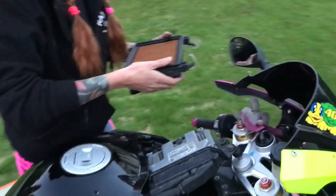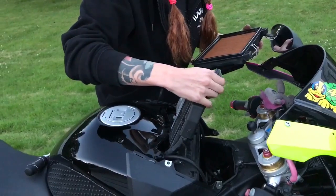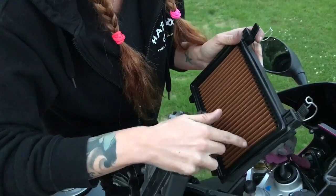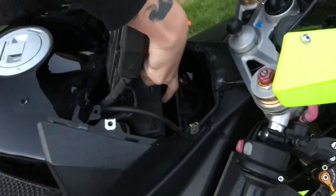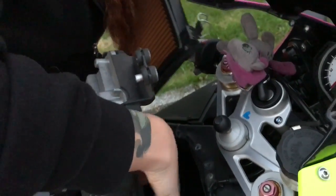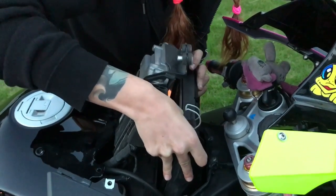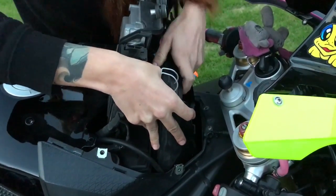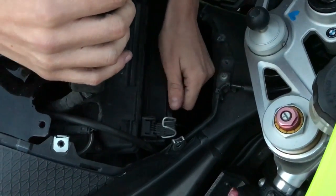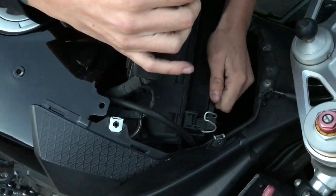Let's put it in. I just placed the easy view like this — I was fixing it up. As you can see, this air filter has this rubber around it, and if you look down here, there is this groove that you want to have this rubber inside. So I'm just going to put it down gently. When you got it down, you can just play with it a bit to see that it's sealed. As you can see, the rubber band is inside the groove now.